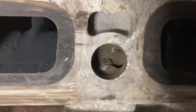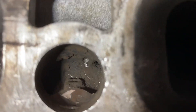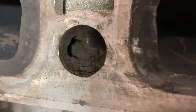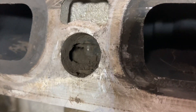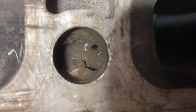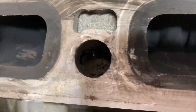Finally, this is the heart of the issue — the carbon buildup in these ports. When you get the freeze plugs off, your ports may look kind of clean, but the center one looks like a transfer port. The sides distribute to the cylinders and you can see there's a lot of what looks like coal in there — carbon buildup from exhaust gases recirculating. I'm going to start by vacuuming out the loose stuff, then take a pick and carve out as much as I can, then spray with cleaner and use a pipe cleaner. Take your time doing this, because once the new plugs go back on you have to start all over again.